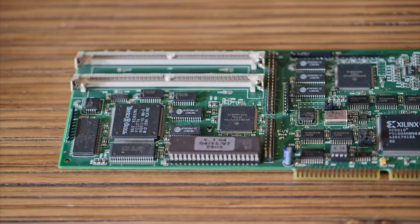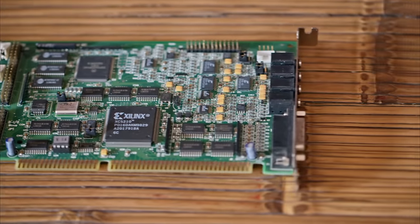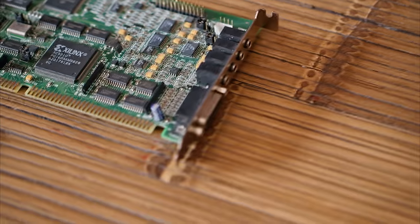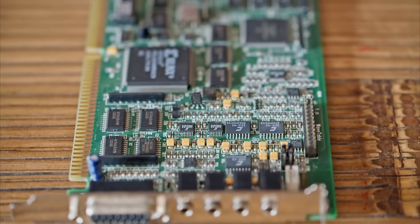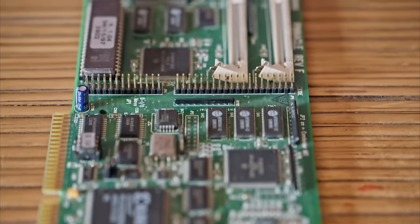So, to wrap this up. Since I don't care about gaming in Windows, which the Pinnacle does pretty well when it's working, the DOS performance is not exactly stellar. It's got some problems with certain hardware. You need Windows 3 to adjust volume in DOS, you need another sound card to get sounds out of games, the WaveBlaster connector doesn't work in DOS, and MIDI interface doesn't work either.